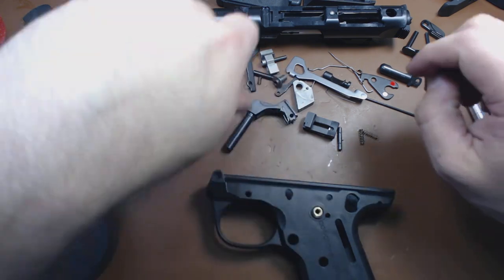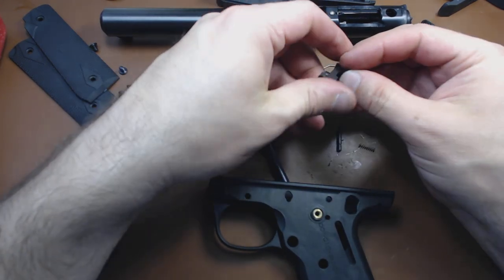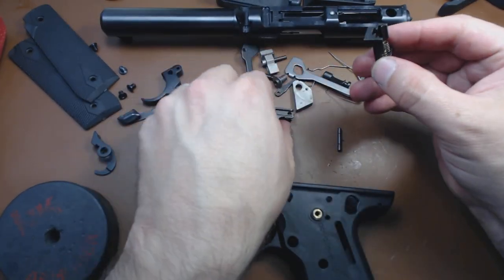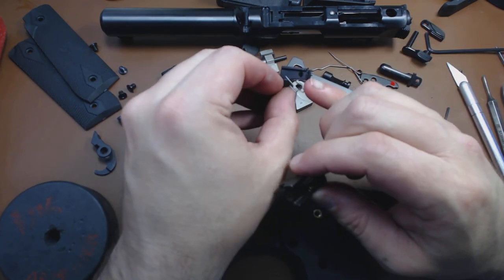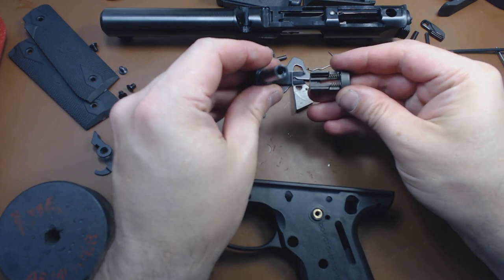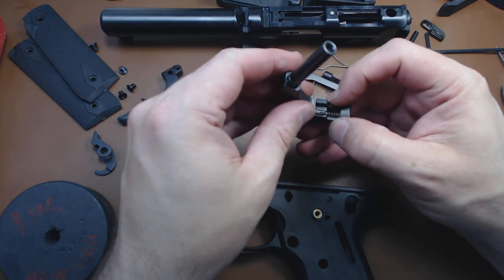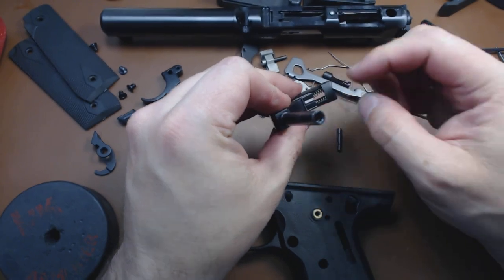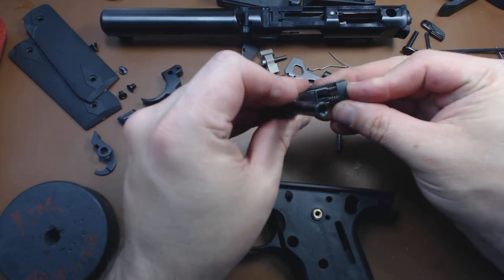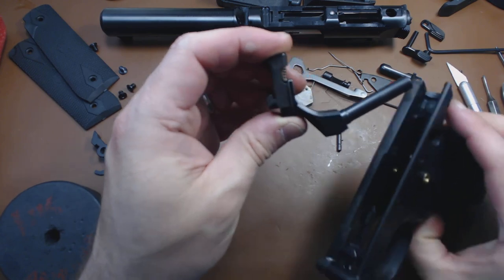So now it's reassembly time. Since we started with the button, we'll put the button back together. The first thing you want to do is take these two little springs and put them back in their little cup. And note these two little nipples on the receiving end there. They are going to engage the far sides of those springs. So I'm going to hold this upside down as I reassemble it, just so I can make sure that those springs actually engage the little nipples. If I'm off, that would make a mess when I went to push the button. It would be bad. So make sure that those are catching both springs, and pay attention to it over the next couple steps here, because if it slips off or you drop it and one of those comes cattywampus again, things will get mushed if you just keep going.